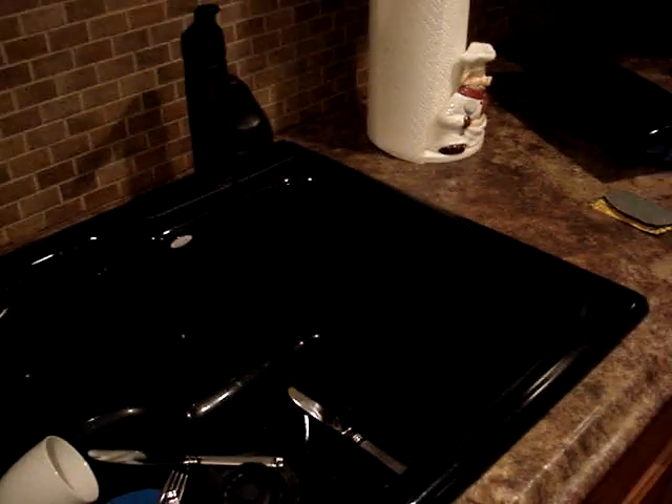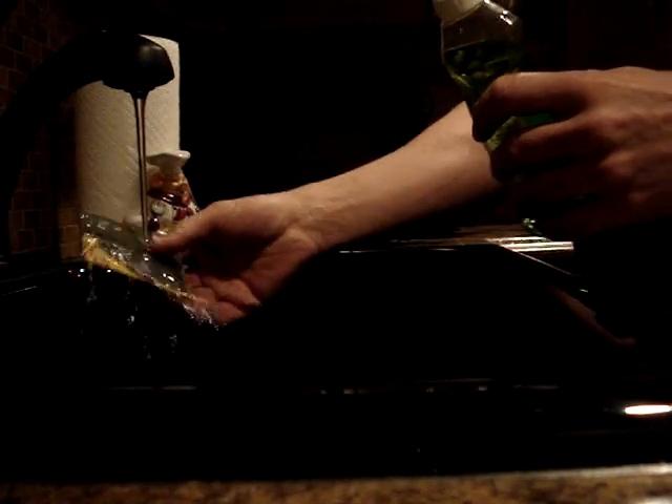I'll be back after I do the first one. Wet your sandpaper, add a splash of soap. Sprinkle some water on your lights to get them wet. Go nice and easy, same direction, not putting much pressure on — just trying to wet the light. After it's sanded, it's going to look all smoky and dull, but it'll be nice and smooth, just the way you want it.